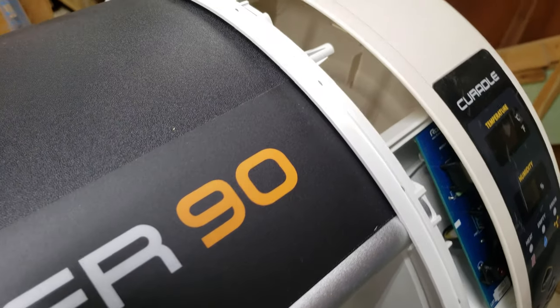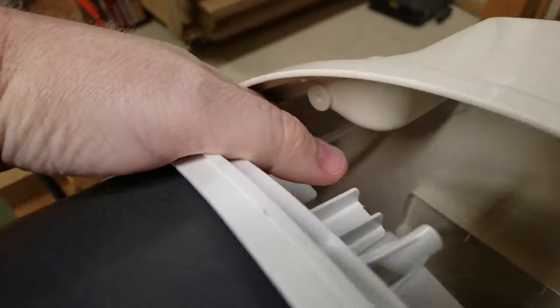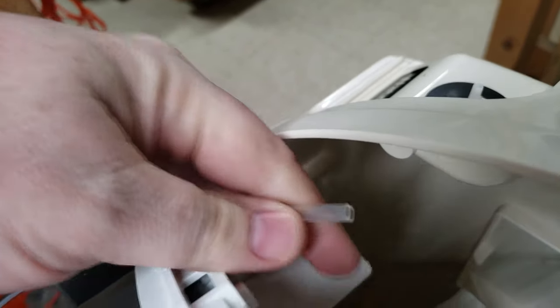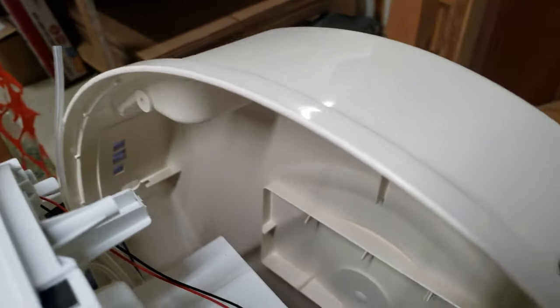You'll want to gently do this, as there are two connections you need to be very careful with on the unit. The first connection is inside at the back, the water tubing connection to the inside. Make sure that it's clear of all water. Reach your hand to the inside and pull that tubing from the top gently. That will disconnect the water tubing inlet hose.